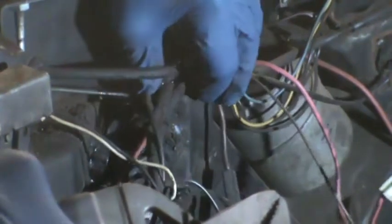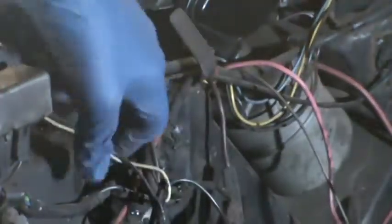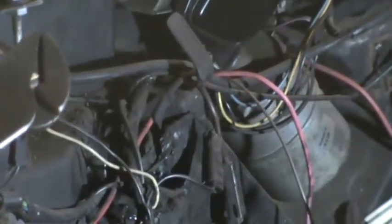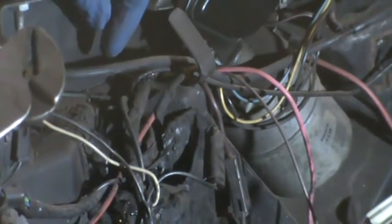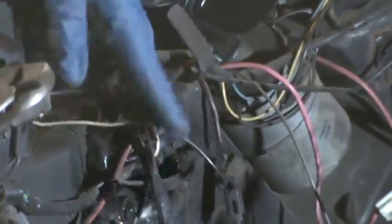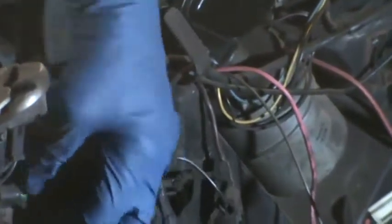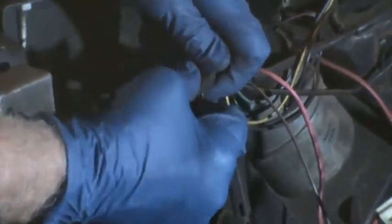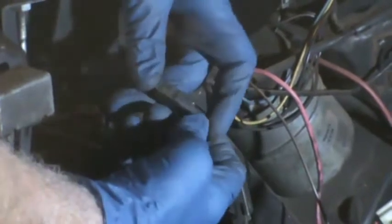Okay, now all this, oh, something sharp down there. All this stuff down here is attached. This is the wiring harness that goes to the starter motor, etc. So you want to keep that. And it plugs into the wiring harness for the air conditioning right here. So we're going to try and take that apart. Oops, pressing it in won't help. You got to pry that one out.